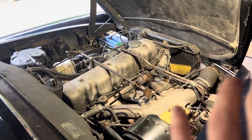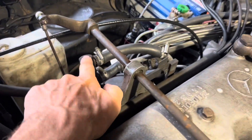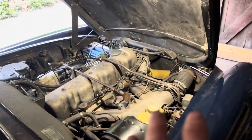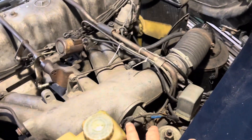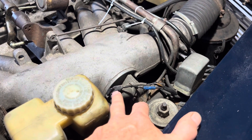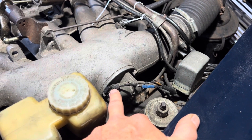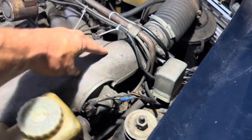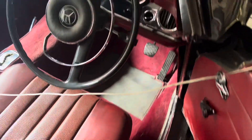Assuming that the car is timed correctly, the fuel pressure is correct, and there's nothing wrong with your warm-up device — we've already done a video on that — if you're having problems starting your car when it's cold, my advice would be to check that when you crank the car you're getting voltage at the cold start valve, sometimes known as the cold start solenoid, which is this unit here attached to the intake manifold. I've hooked up long wires clamped to the car with a magnet so I can test from inside.